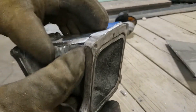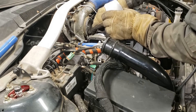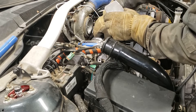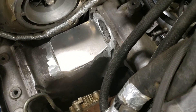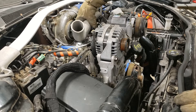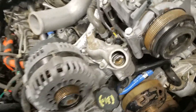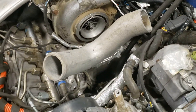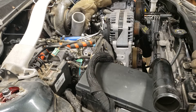With it fitting flush and sitting in place, we'll take it back to the car, bolt everything back into place, get the plate set on there, and mark the position with a Sharpie so we know where it's located. Then we can start mocking up the two-and-a-half-inch aluminum pipe. This piece of pipe is off an intercooler from a tractor I grabbed at the junkyard - it has some nice bends. After some mock-up, the best route was just to make a short stubby piece and use a silicone boot to make the 90-degree turn toward the alternator.